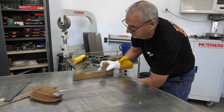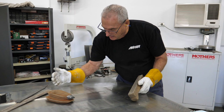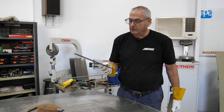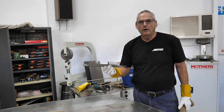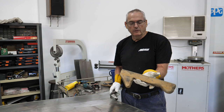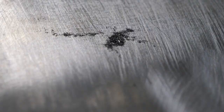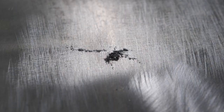So I've been using the flat lathe file - I'll do a close up on that in a minute. I would probably normally use my old faithful body file - a proper body file, very coarse, just got to be careful of edges. I really like it. The handle is a daggy old bit of timber - when I first started doing this on my first old burgundy car I couldn't afford to buy one, so I got a bit of timber from the old man's workshop, made the shape to suit my hands, and screwed it on. That's probably been going about 40 years now. These body files are a bit coarser and take metal off quite quick - you can see there how much metal that took off. So whether you use one of these or a good clean sharp file, either way you'll be able to do what you need.